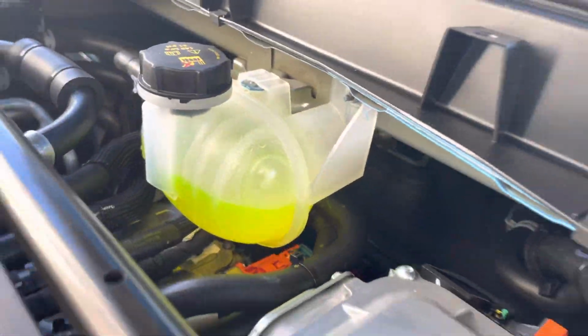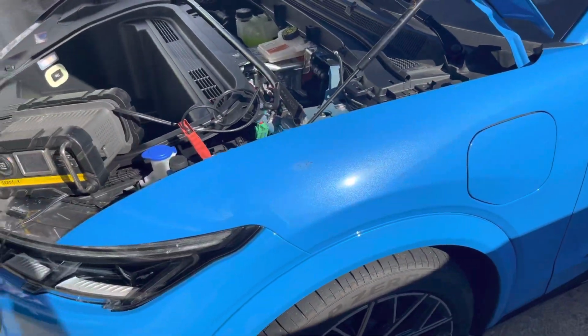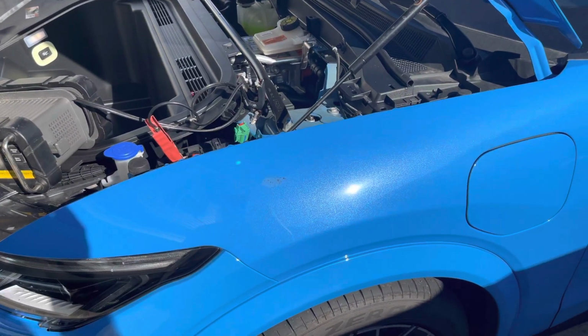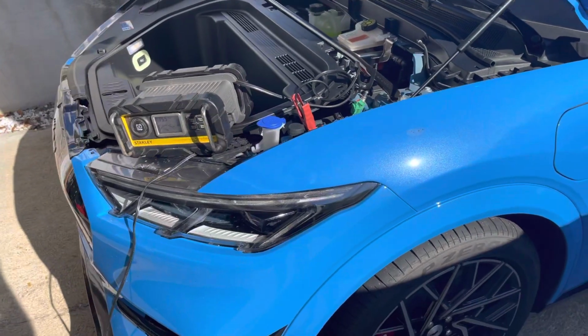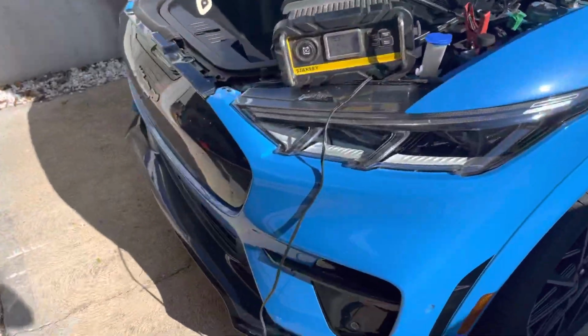It runs the coolant pump at full blast when this happened, as well as in the GT, the front and rear motor transmission fluid pumps. And the non-GT, if it has a front motor, the pump does not run because there's no pump in there. It's just coolant. And it also opens the front shutter grills.